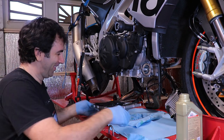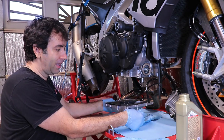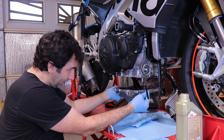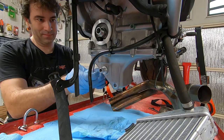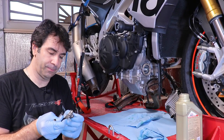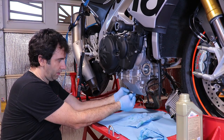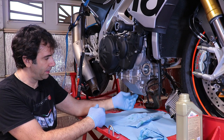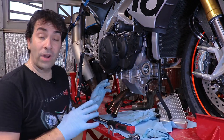I'm going to position the pan using one bolt up front in the middle and one bolt in the back to keep the gasket in place while I bring it up. Once all the screws are in place, there's one additional screw that holds the little fairing at the bottom, which goes in at an angle. I'll keep that one loose for now and tighten it with the fairing on so I can adjust the fit, then I'll tie everything down at the very end.